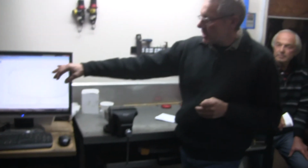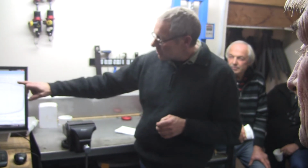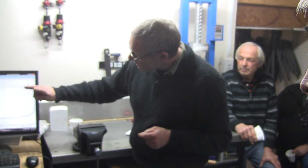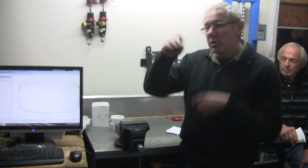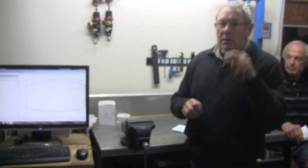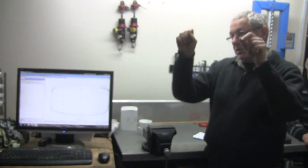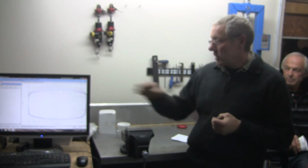The biggest issue is that if this shock is the same graph looking as the next shock, it may be that this line is, let's say, a 3 on that shock, it could be a 5 on the other shock. So what we do is we produce a table that says that shock number 1, the left front, a 3 on the left front, it has to be a 5 on the right front. And that doesn't necessarily stay linear as it goes up. So we just make a little table up so that you can see that, and we can just lay it over the top.